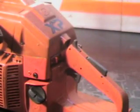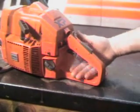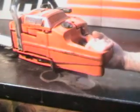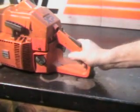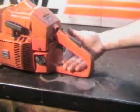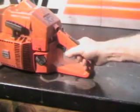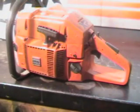And the foot pad and hand protector — we've talked about these before. It helps protect your hand in case of a chain-throwing incident, and also doubles up as a foot pad for starting this chainsaw on the ground. Just put your foot right in here, hold the saw on the ground good and solid, and get a good grip on the handlebar for an easier start.